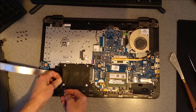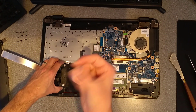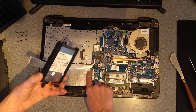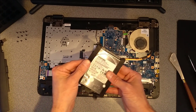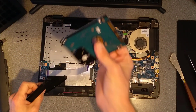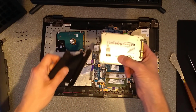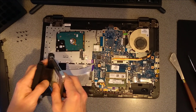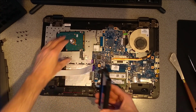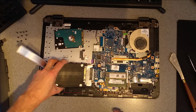Be mindful that there's a connector that's soldered to the board there, so you don't want to try and rip it out from this end. I'm going to lift it up at the non-motherboard end slightly — probably just that far off of the case — and then wiggle it away from the motherboard, and the hard disk comes free in what looks like shockproof mounting, which is quite good. So there's the old hard disk. I'm going to get the new SSD and put it in the shockproof mounting, then put it back in.